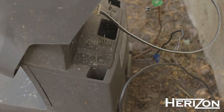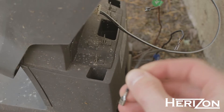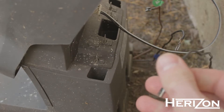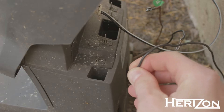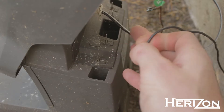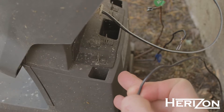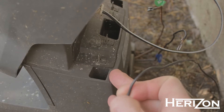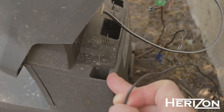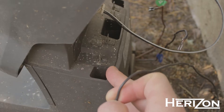Next, turn on the charging station and connect the troublesome boundary wire lead to the AR or right side of the boundary wire terminal. Keep all other terminals open or unconnected. This gives us the best result for finding and pinpointing where the cable break is. Only use this AR or right terminal.